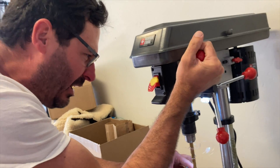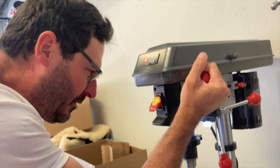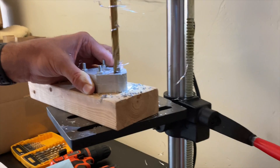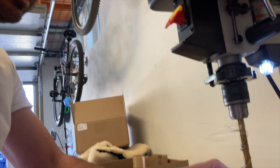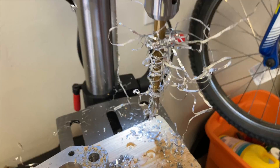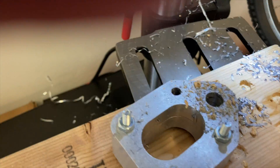What I'm working on now is the lift strut to the truss brackets. You have to drill out every one of these five holes — the big one to 7/16, small ones to 1/4 — so we're just taking our time. Looks like it'll turn out good. I am super motivated to get this wing done — it's going to be done tomorrow. I'm holding myself accountable.